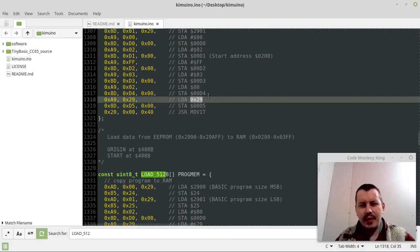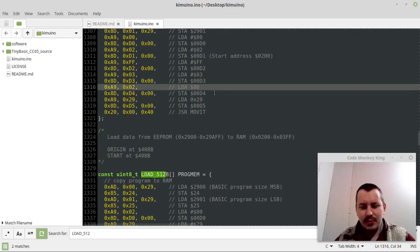Okay, guys, I'm sorry, I forgot to fix the commentaries, because I remember that it's not 00, it's 02, because the first 2 bytes are reserved for the program length of the basic program. Sorry, I saw this error in the commentaries and thought, what the heck is going on? Okay, so now it's fixed. I need to upload this to GitHub to make sure the latest version is available. But anyway, the least significant byte of the new address where to write the data is 02. So skip the first 2 bytes. And then the most significant byte is 29, stored to D5.